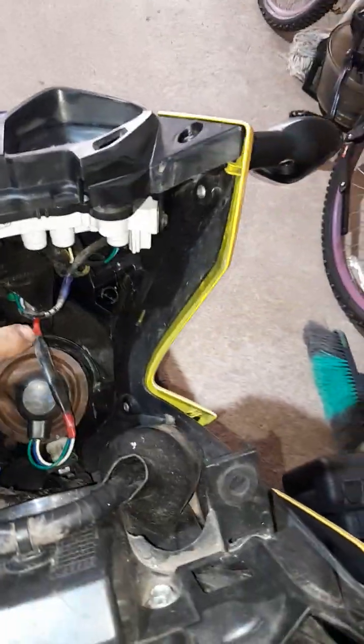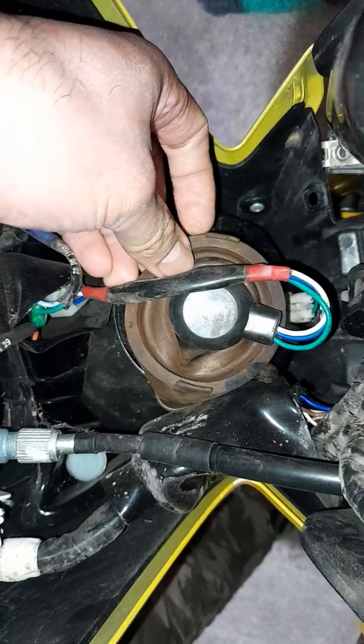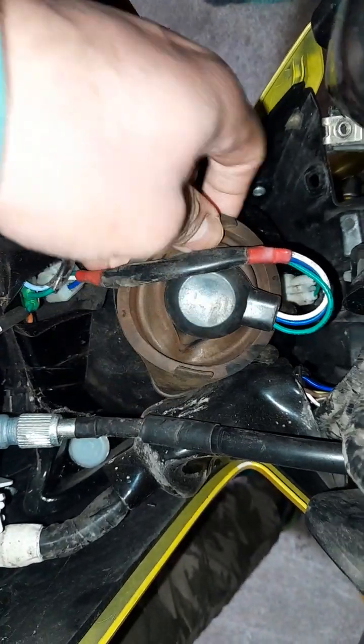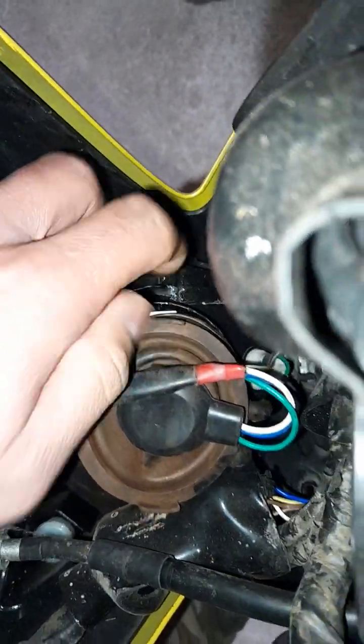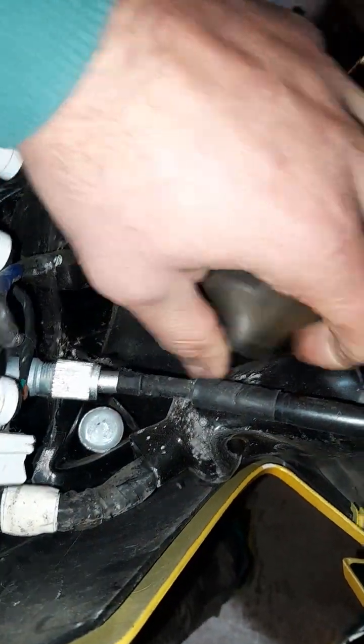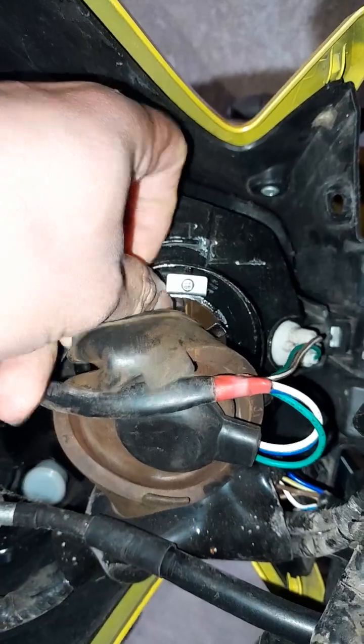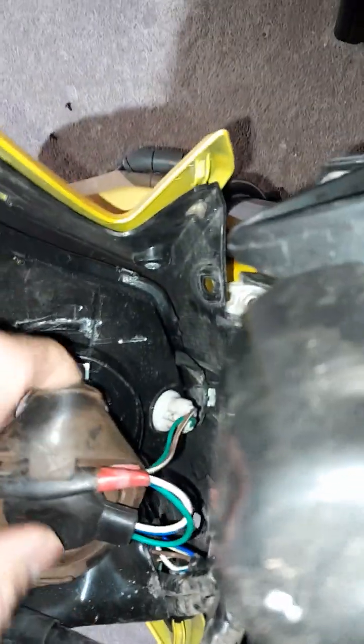Just be careful guys, because we have loads of wire connections over here, the speedometer wire, and all the indicators. I will show you in my next video how to change those indicators. So here we are. That's our main headlight bulb. We have 2 click wires like that on the other side as well. Let's pull that up. Yeah, so that's it done.